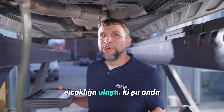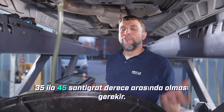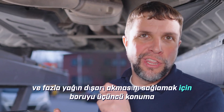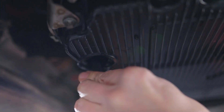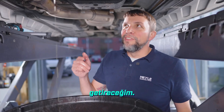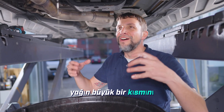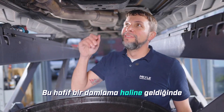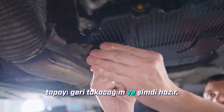The transmission is finally up to temperature, which right now is at 38 degrees Celsius — it needs to roughly be between 35 and 45 degrees Celsius. So now I can disconnect my tools and put the pipe into position three to let the excess oil drain out. To check the level of the transmission, the engine needs to be running for this process — that keeps a lot of the oil up in the transmission where it belongs and not settled down in the pan. Once this comes to a slight dribble, I will turn the tool back to position one, put the plug back in, and now it's ready.